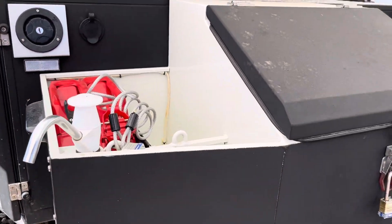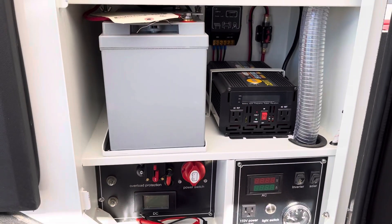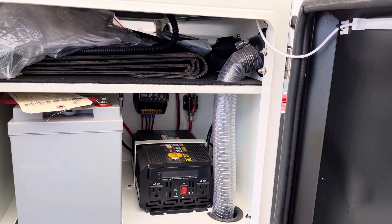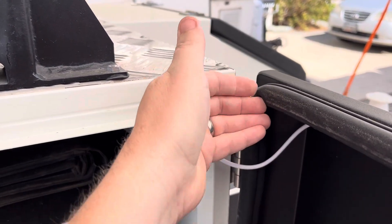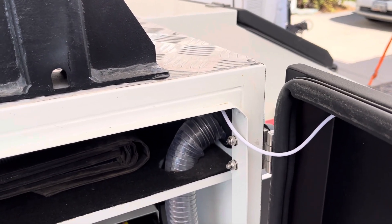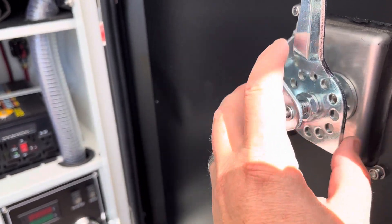I do love the power center. We got a solar panel because we got a fridge now, just to make sure we have enough power. One complaint — and I think people should keep an eye out for this when buying — I don't blame Tribe, I think it was actually the dealership. The gaskets up here were creased, and when it rained we were getting water leaking in. It looked like something had been closed in the door and just pressed them in. Tribe sent us some gasket material; my wife and I replaced it. We still have a little bit of leaking but I think that's me figuring out the right tension.